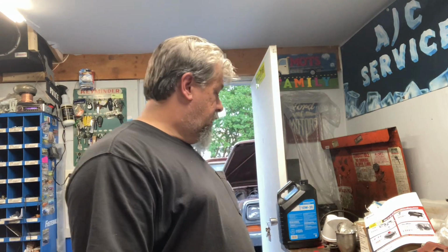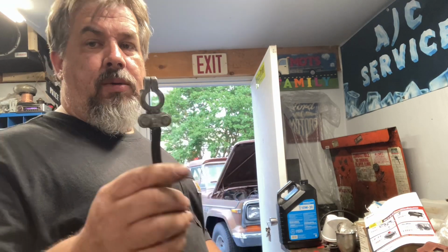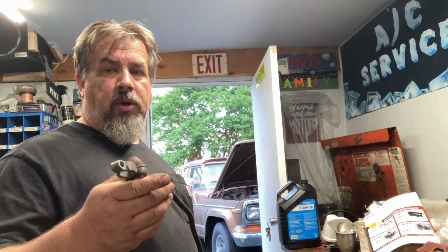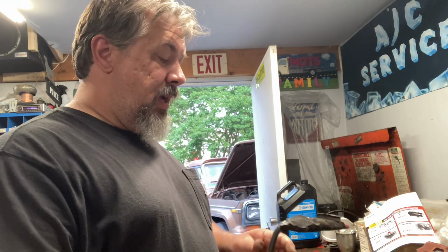So today we're fixing lights on it, putting a battery in it, and the battery cables have these on them. Now these ends are good for quick repair, quick roadside repair, or you know, car won't start one morning, battery cables trash. These are good to get you by, but these are not a permanent fix. And guys always use them as a permanent fix. They'll never understand it. So we're gonna make some new cables today.